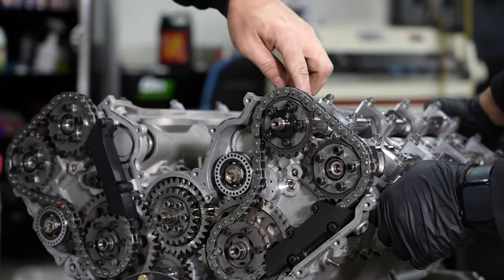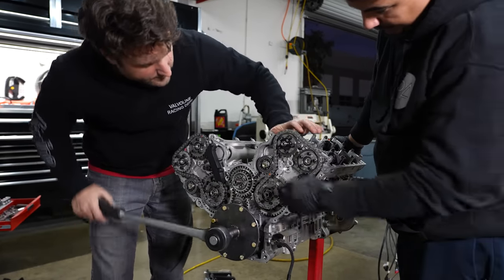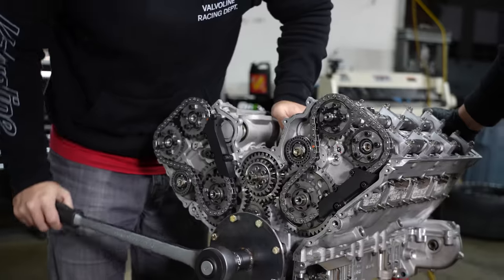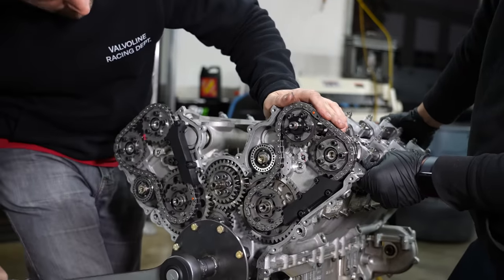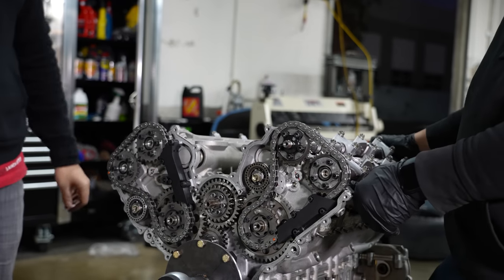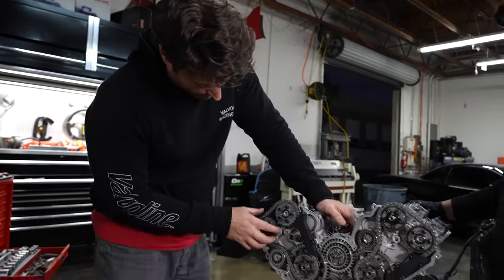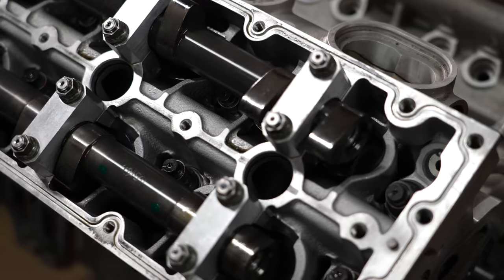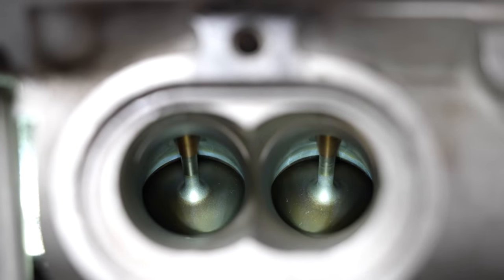It's something that sticks and then lets go — it's tight here and I can see it popping up and over the tensioner. This is under tension. It's loose here, so it has to do with a cam holding back and letting go. It is literally fighting the peak of the camshaft. I'm not too worried about that noise at this moment, because it actually kind of makes sense — this is just incredible.